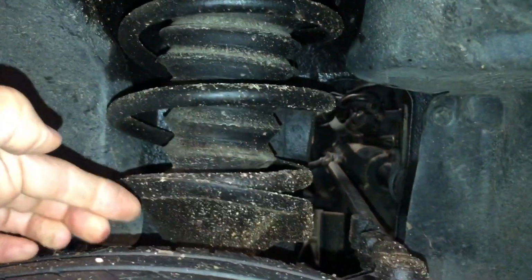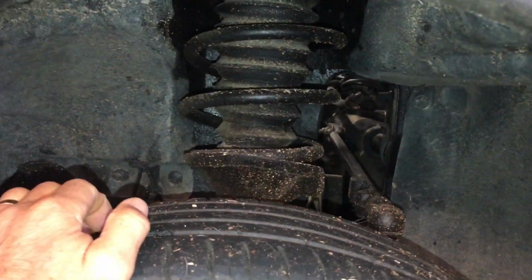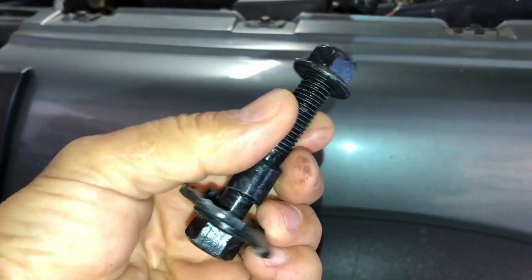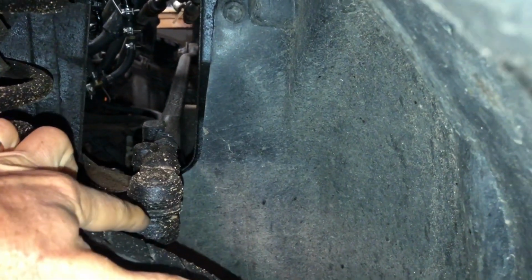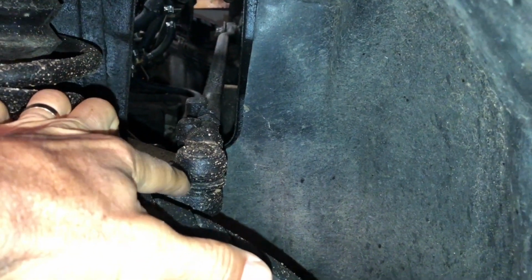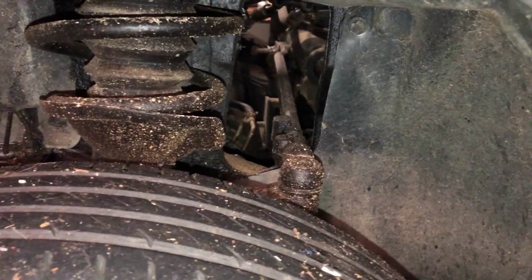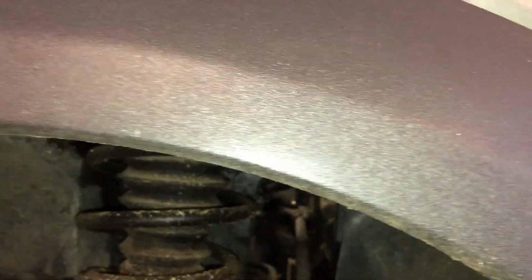You have to take the 2 bolts and nuts off the bottom of the strut. One of them you really want to take off anyhow to put the camber adjusting bolt on, which comes with this kit. This is this thing here that replaces the top bolt and nut on the strut, the top of the 2. You can do it without removing this steering arm track rod end ball joint. Often those are a bit of a pain to get off because they're probably quite rusted on, but you can leave it on, and it's just about enough movement to get the strut in and out. Just leave it semi-dangling in position off the steering arm.